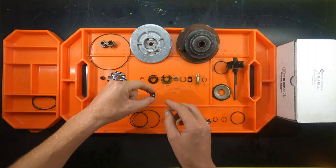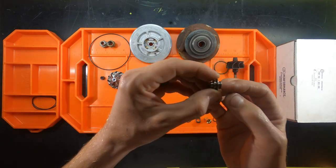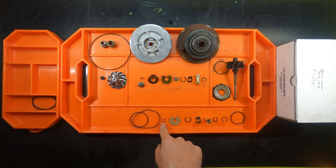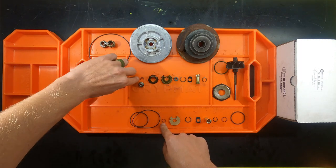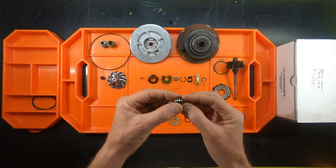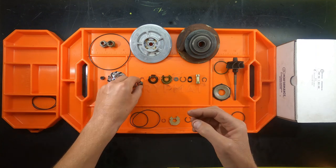And then this small bezel that went inside of the unison ring, there is another piston ring or a sealing ring that goes in there. It does come with a replacement in the kit, but unfortunately I snapped this one in half getting it out. It was quite difficult, so obviously when you're removing that, whatever tools you use, pick pliers, just do your best to make sure you don't damage the inner groove in there.